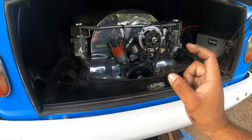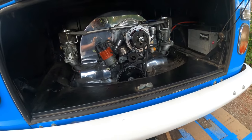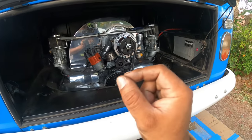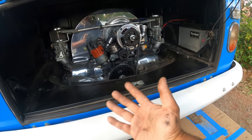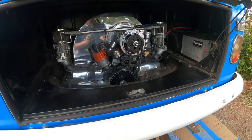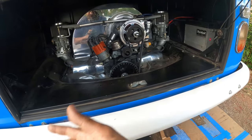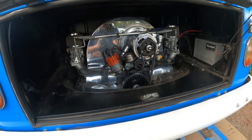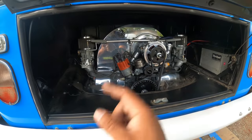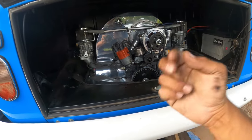And that's it. Put your valve covers back on, fire it up. Make sure you don't hear any loud ticking noises — if you do, find out which side of the engine it's coming from and redo your valve adjustments. You will get minor ticking — that's pretty much the nature of these engines, very very little ticking to almost none depending on the build. We are using a 1776 fully built with a counterweighted crank and big flow heads on our VW bus, so this is a little bit louder than a normal 1600cc motor, but the procedure is exactly the same. Thank you for tuning in to this episode of Pinchy Owl's Garage with Pappy the Bus and our air-cooled motor — how to do a valve job. See you guys next time. Peace out and have a wonderful day.